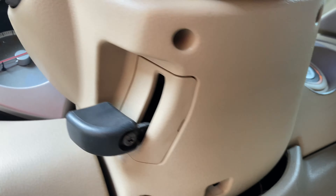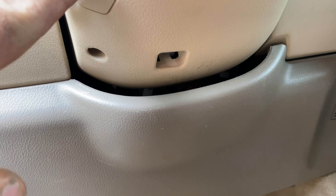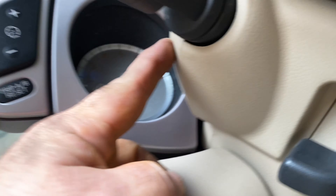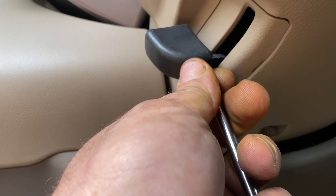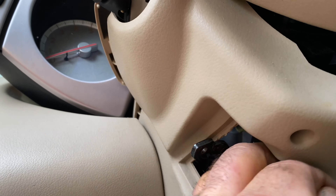To get to the stock, take off a screw here, here, here, and here — I believe they're all Phillips — and that'll let us split this in half because there's a top half and a bottom half. So I'll pull those screws out and show you what's next. Once you take the screw out of this handle, this handle slides right off. Then we can pull this piece of plastic off and start pulling these apart.